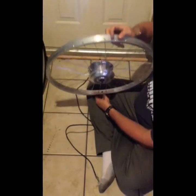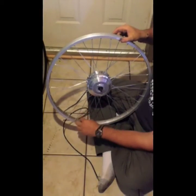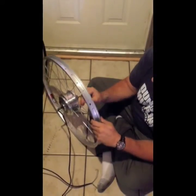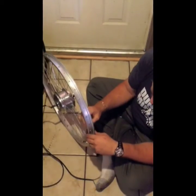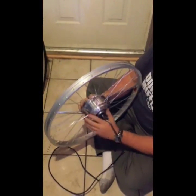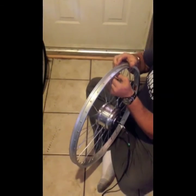You'll notice that the valve stem down here — these two spokes are almost perfectly parallel to each other, so you get really great valve stem clearance. You can get about 5 inches in there if you wanted to. So yeah, that's it — thank you. I'm going to finger tighten these up now. If you watched to the end, I applaud your patience — thanks for watching, keep in mind this is my first time making a wheel lacing video.